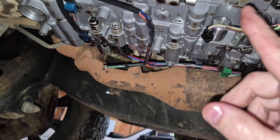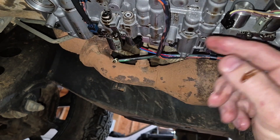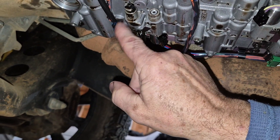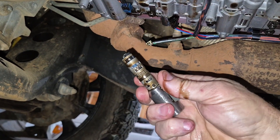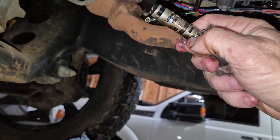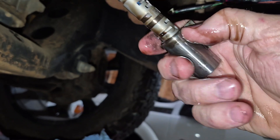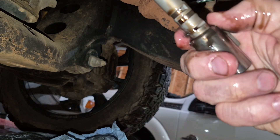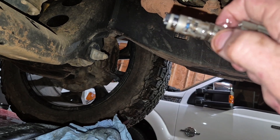Now here's the SLT — that was the SL2. The SLT is over here on the front, the other side. They kind of interact with the pressure inside the transmission. Those little pins that come out of the hole there, they slide out — the solenoid just pulls out. You can see where the pin sits right here — not in that hole, but in that groove. They sit in that little groove, and these other grooves go into the solenoid actuator, and that's for fluid to transfer through.